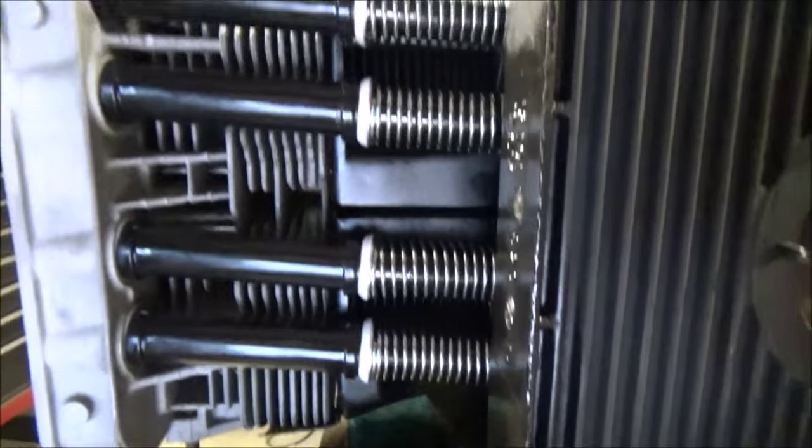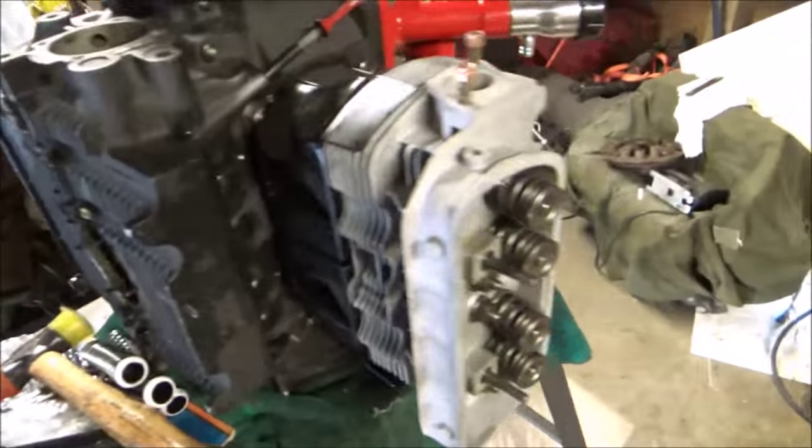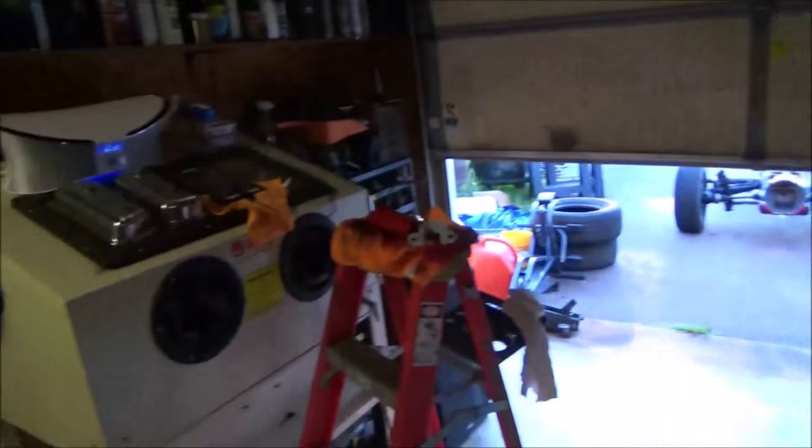Looking pretty good here. This side is all done. There, all the tubes are in. The next is push rods, and then rocker arms, and then torquing that, and finding top dead center on every one, and you'd name it. I don't know where my push rods are, though. One of those things. Put it down.